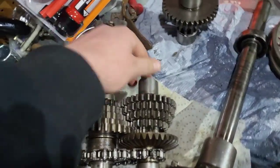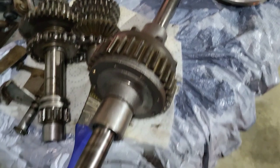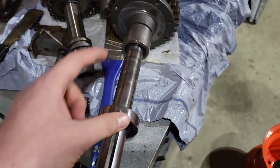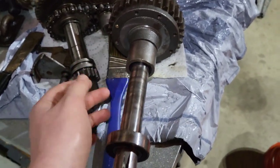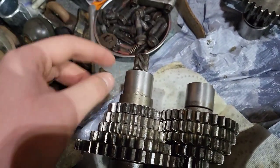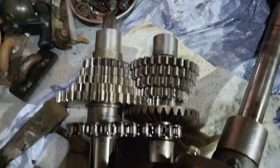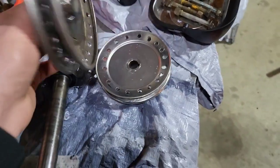These things can now spin very easily. Same thing with these seal bearings — I like to pull these off and pack them full of grease as well. I pull them off, grease the shaft that this rides on, then it works just as good. Enough transmission talk — we're going to get these pulleys on. Obviously I can't put this one on yet because I need the trans together, but I just figured I'd share that tip.